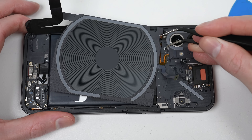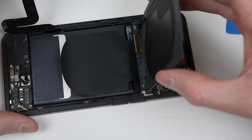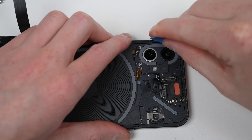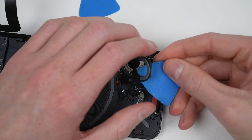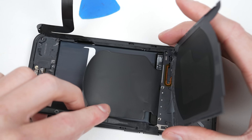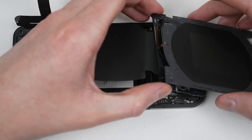With the wireless charging coil out of the way, we have revealed yet more hidden screws, one of which is under another liquid indicator. Oddly, these screws are Phillips. And just when I thought there was no place left to hide a screw, I was again proven wrong — lifting up the camera LED array reveals two more Torx screws. But with 16 screws out, we can finally get our first look at the motherboard of the phone.